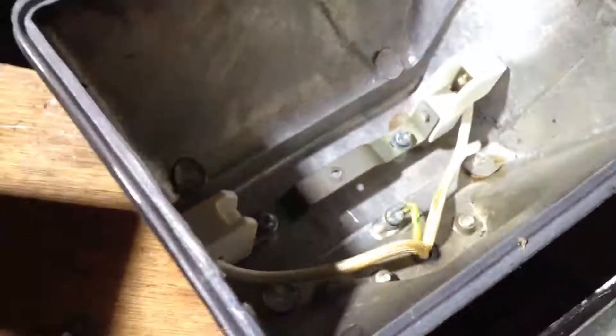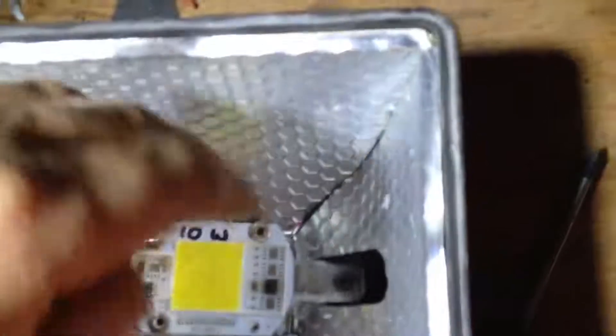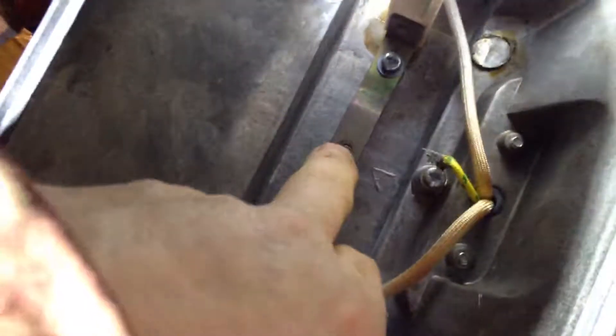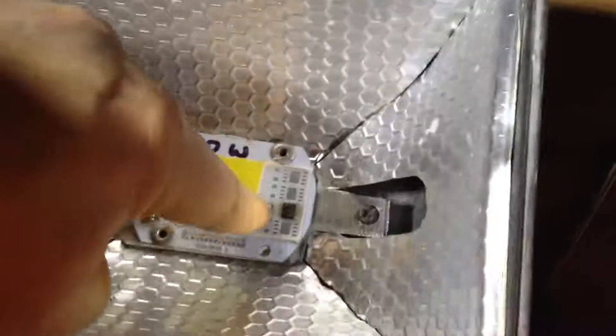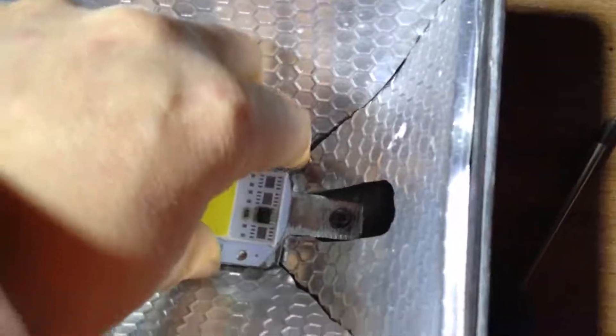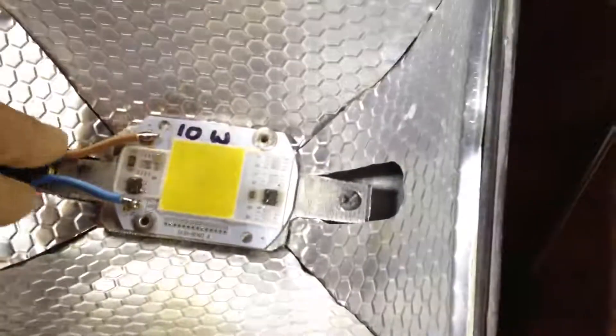So the idea is — just take the lid off — you can see it looks like there's a big square or rectangle just here, and two little fingers off left and right. The way it works is you put down your reflector like what I have here, and it bolts again like normally into this point here. Then the little tabs I said you bend, so they will be drilled through the aluminium and bolted to those little tabs. So now you have a base to work off. Then you put down your heat compound paste — just a big blob in the centre. Don't put loads of little ones because you end up with little air bubbles, so just one in the centre, a big decent blob. And then just push down your LED straight onto it, and you'll see it coming out the sides. Then just put in your — I use pop rivets because they're nice and handy. Just put them on, and then just solder your two wires straight on, and the job is done.